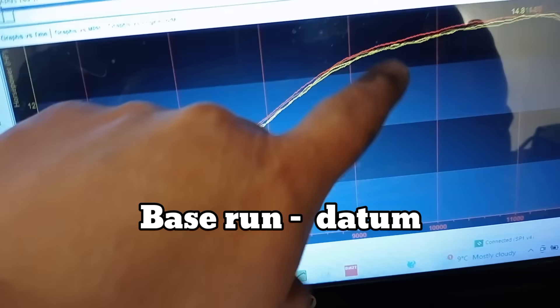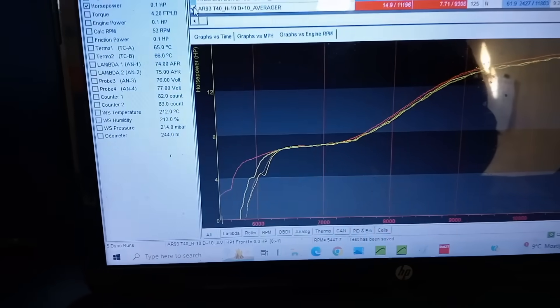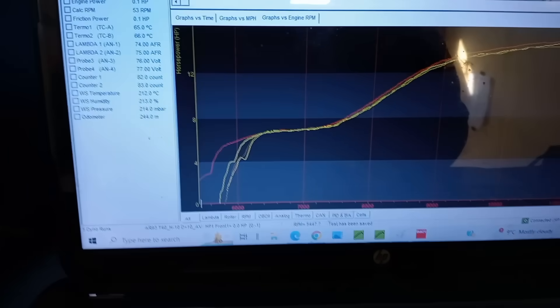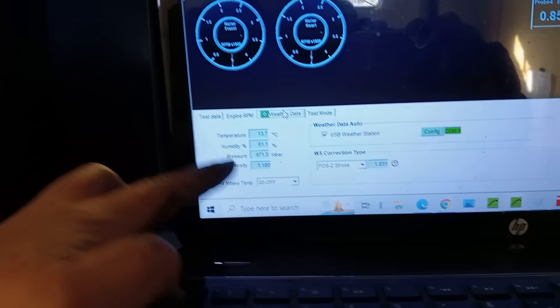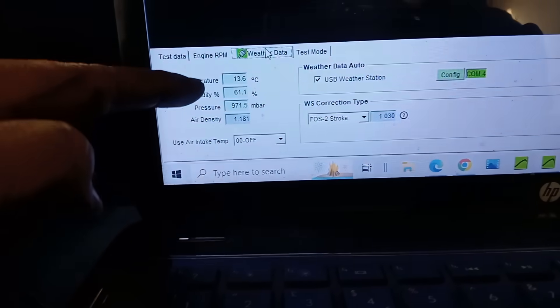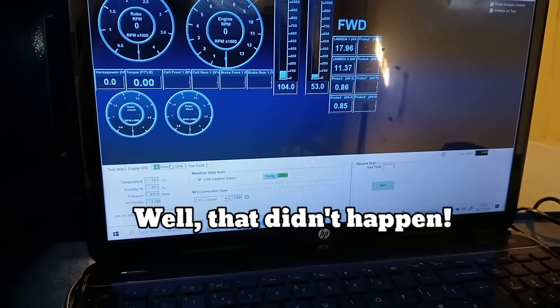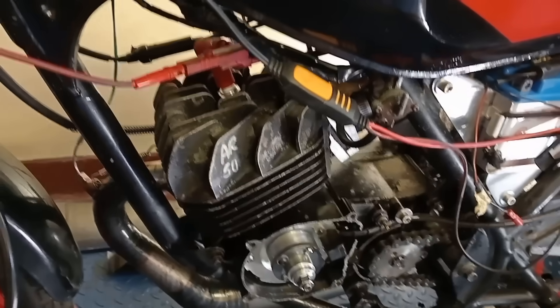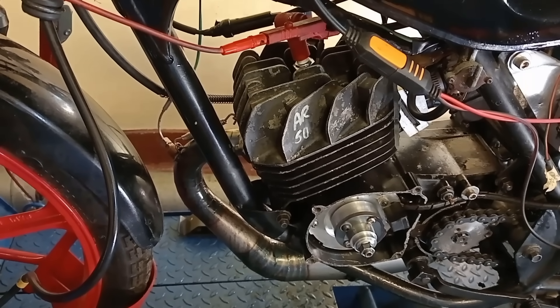Right, just completed the first tests. This is what I've done and that was the best I had from the other night — roughly about the same, not too bad. I've modified my start procedure by starting at 6,000 rpm because there's a little bit of spluttering. I like to do all testing in one day. It's quite low pressure today so there's a big correction going on — whether you should use corrections or not, I'm not sure. That's why I want to do all the tests today. First I'm going to take the barrel off, unclip everything, re-measure my timings, and start from there.